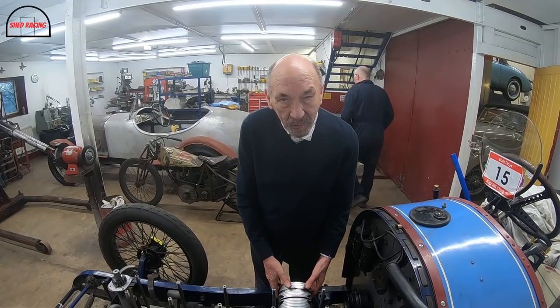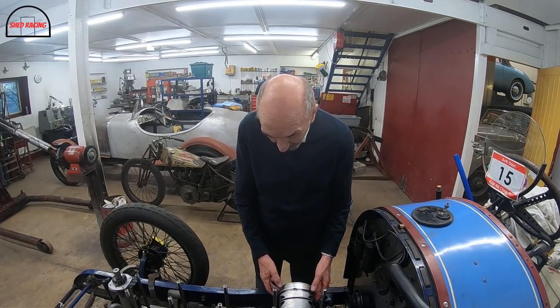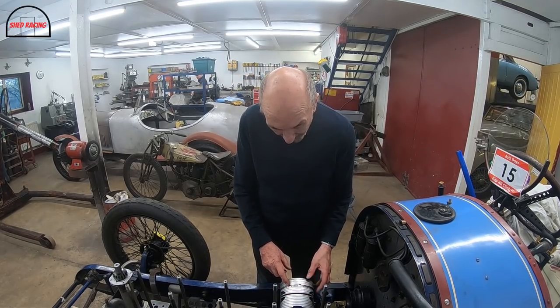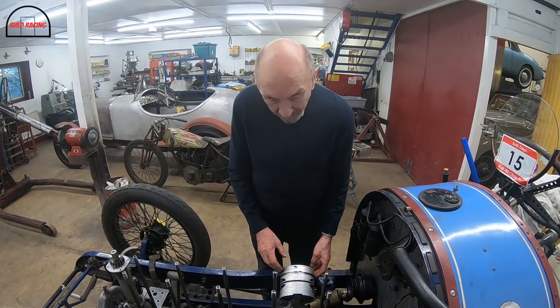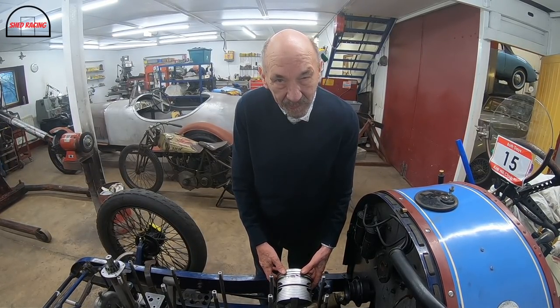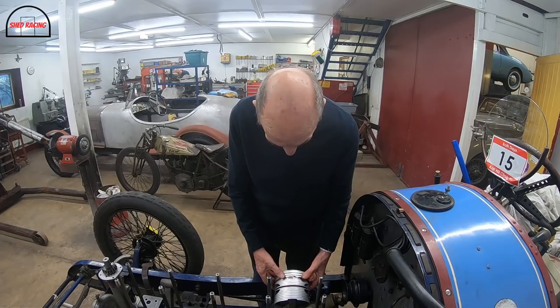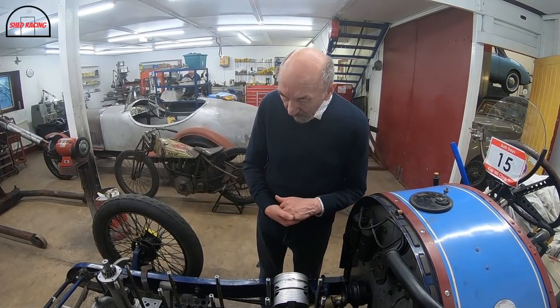Because, you know, I was thinking, oh, we're going to have to sort piston rings out. Well, you're never going to get piston rings like that. But even when we left that ring off, it didn't smoke. And it don't smoke now. So, you know, I think the next time we take this to bits, if we ever do, it's going to be some new pistons with modern rings, little narrow rings, you know. But it works so good, it's hardly worth the bother.